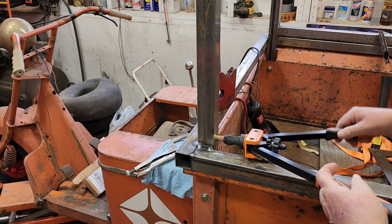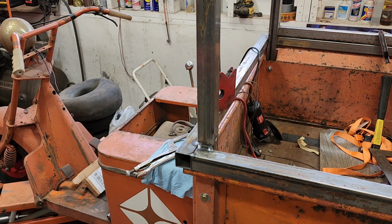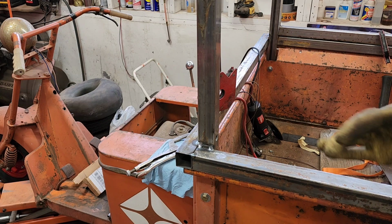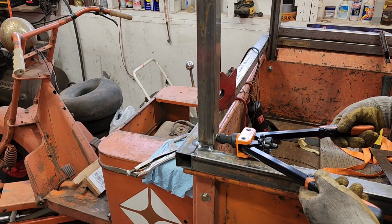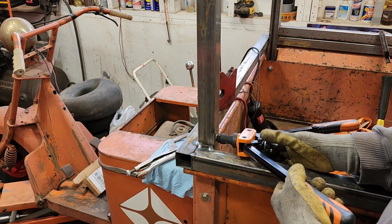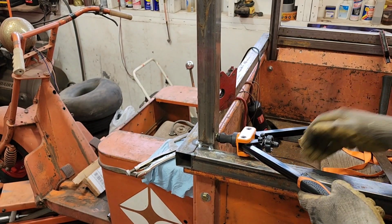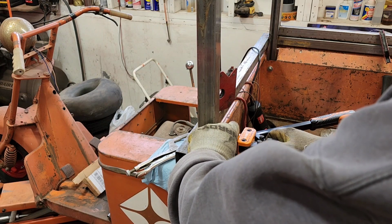So, that was the correct size. Maybe I gotta waller it out. Yeah, I didn't have it all the way to that last step. My bad. Okay, so then you insert the nut cert into the hole and you pull this like a pop rivet. I'm gonna have to get behind this because it's a good size rivet. Okay, I'm not quite there, so I'm gonna loosen that up. I'm gonna tighten this. I'm gonna take another pull on it. Not quite there yet. I'm gonna take another spin on it. Oh, I'm spinning the die. There we go.